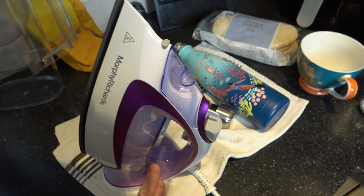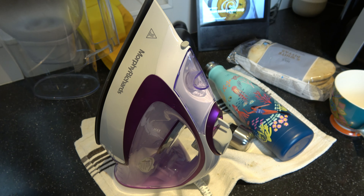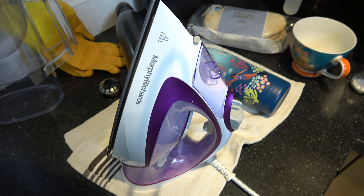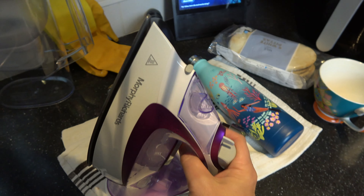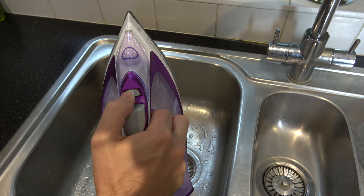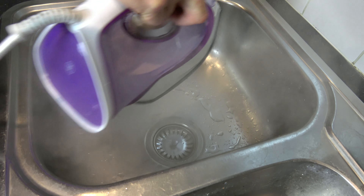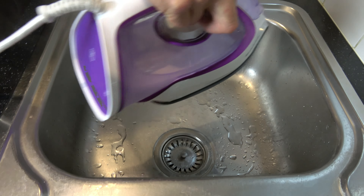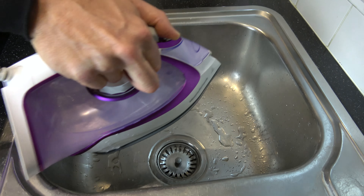The light's gone out now, so while it's still hot I'm going to unplug it from the mains and bring it back over to the sink. Do not touch the sole plate — you'll burn your hands. I've unplugged it and I'm coming over to the sink, putting it to the very right-hand side on self-clean. I'm moving it forward and backwards horizontally, getting the water splashing around, and you can see all the steam coming out. Keep your thumb over on the right-hand side on self-clean.